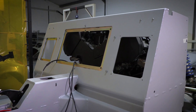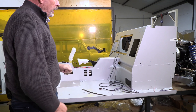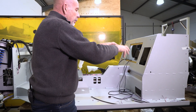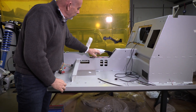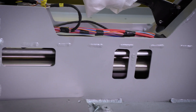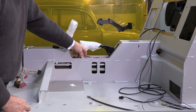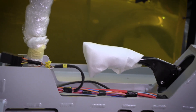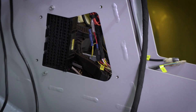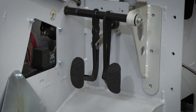All the holes are already drilled and tapped. We do not supply a battery because you would use the battery available within your country, but the space is there with a battery bracket. In the center of the chassis, you can see the water pipes, which are supplied. Your vacuum hoses for your brake system, the actual brake flexi-hoses, and the clutch flexi-hoses are all supplied. A full loom is supplied. You get a handbrake with all its cables, a gearshift mechanism with a gearshift knob. You can see the fuse boxes at the front and more of the loom, pedal box — left-hand drive or right-hand drive.